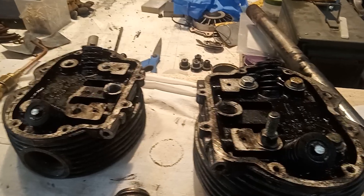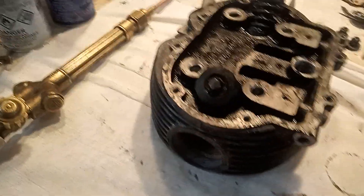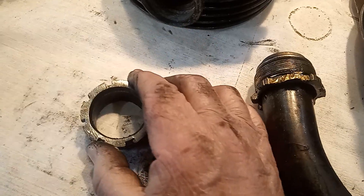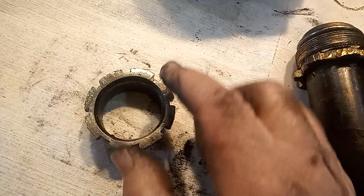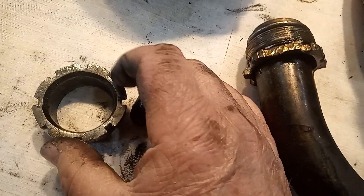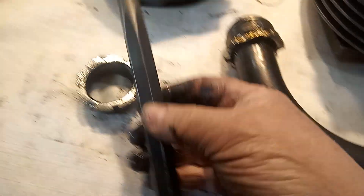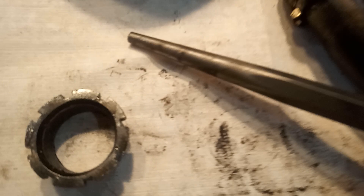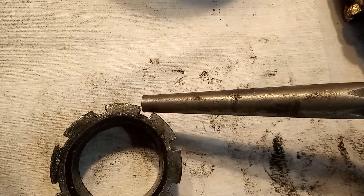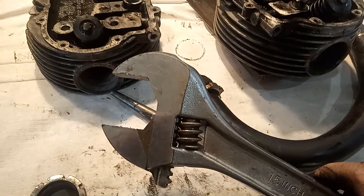Lemon juice and vinegar — your old grandmother's remedy for cleaning cooking ranges and things like that. When it comes to knocking these off, a C-spanner is a waste of time. I'm going to make a C-spanner that encloses the whole thing and grips on all of the lugs, because the regular C-spanner only grips on one and it just rips the corner off if you give it any heave-ho. If you use a nice big punch like this, if you look at the angle that you can hit it, you're still only hitting the edge.